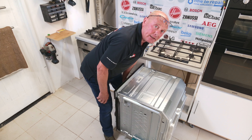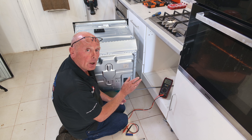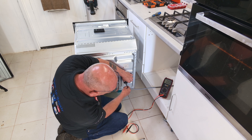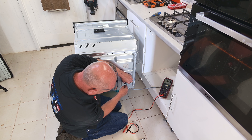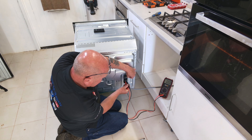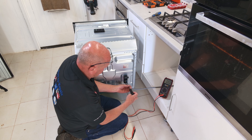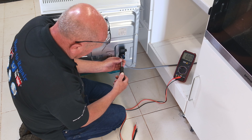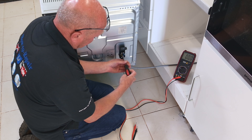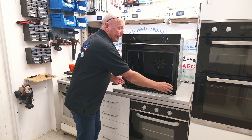Turn the cooker around to the side, making sure that you're not pulling the cable too hard. If your oven is plugged in, you'll now be able to remove the plug. But if it is hardwired in, we have to undo the electrical connection. You may even have an isolation socket behind the cooker — just put a small screwdriver in to lift the two clips. Do go across the live and the neutral connection to check there is no electricity present. Once confirmed safe, undo the retaining clip, then undo the live, the neutral, and the earth. The cable can now be pulled out and put safe.